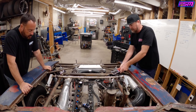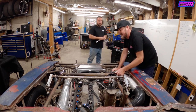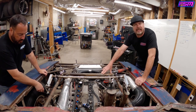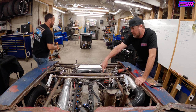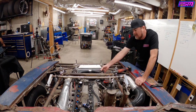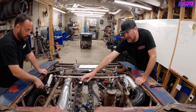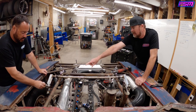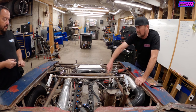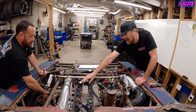First things first — strut bar coming off. People always ask about this. So this is our strut bar; it's made out of one of the door bars from Blasphemy. We welded bungs here for AN fittings for hoses. The hoses go to the valve cover, which ventilates the crankcase into the bar. The bar has two breathers on it and a drain hole in the bottom with a pipe plug. Someone noticed we have push-on breathers on the valve covers that could route to the other bung on the strut bar — originally this was for the 383 with two valve covers, two hoses, one off each. We could pop this off so it's venting to atmosphere into the bar.